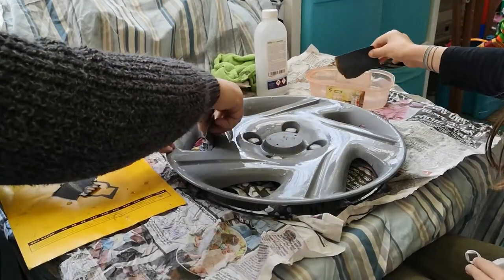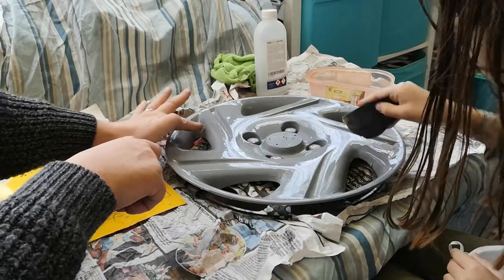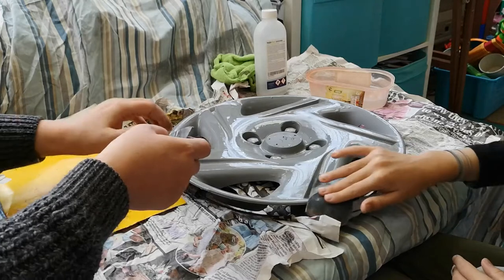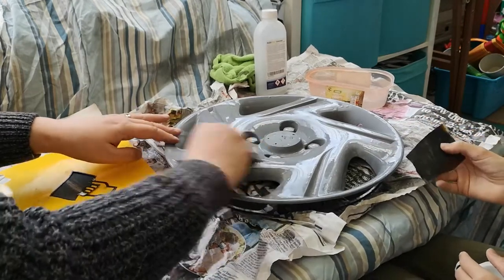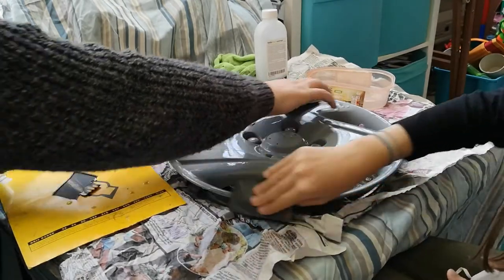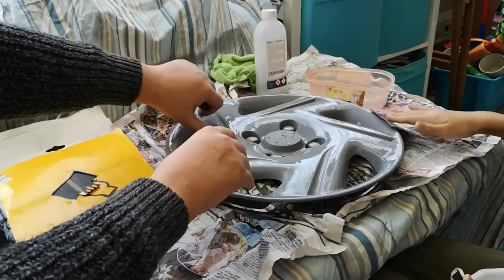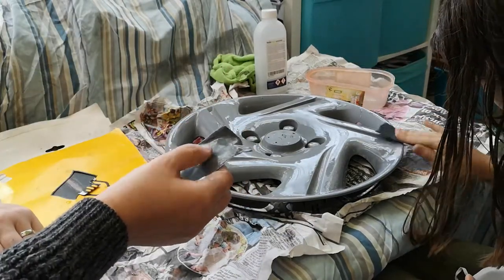What you will notice, particularly on some of the areas that haven't had quite a good layer of primer, or quite as much coverage, is that you actually go back down to the original material. In these instances, what you would ideally want to do is to apply another layer of primer. However, it's only one area that's affected, so I'm going to be lazy and just apply the top coat, mainly because the top coat is going to be the same colour as the colour that's underneath the primer.